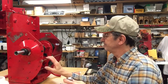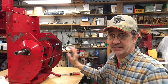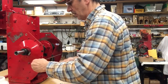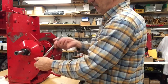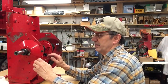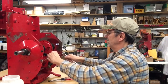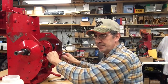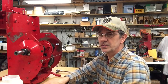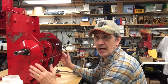Next we'll take off the spreader bar. This is about one of the few I've ever seen that's not bent terribly—it has a little crown to it, not bad. Most of them are bent so bad it's going to put a strain on your bushings. I know I'm going to rebuild it and sell it. I'm kind of leaning towards installing fenders that accept bearings instead of these crappy little bushings, so I'll actually have ball bearings on the drive train.